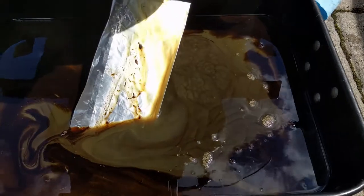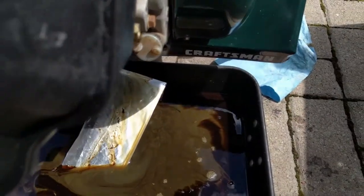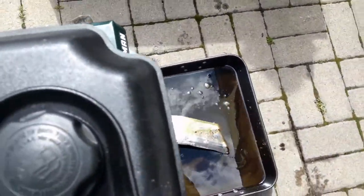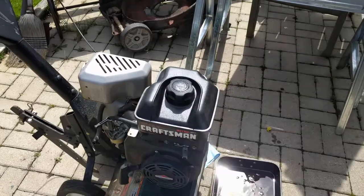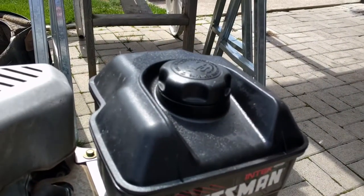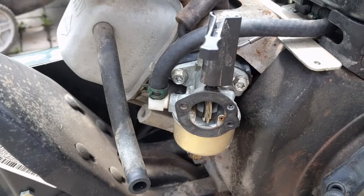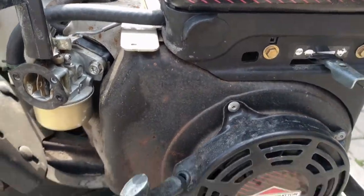It's a good thing I wasn't running this thing for long. I fired it up and it ran fine up until it started pissing out all that water from the overhead valve breather tube that goes to the air filter. What happened was he left this sitting outside — water got into the gas tank, there's no shutoff valve on it, so water mixed into the gas and went down the line into the carburetor, and because the float was stuck that went right into the cylinder, past the piston, and down into the bottom end.